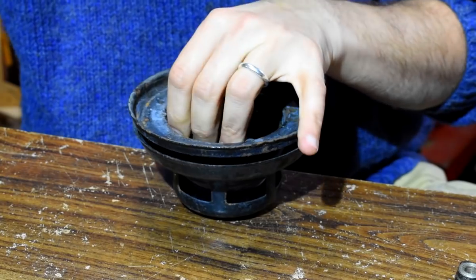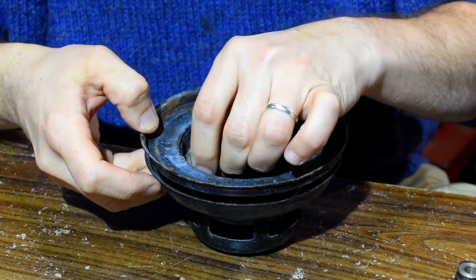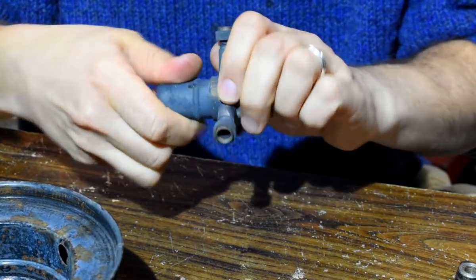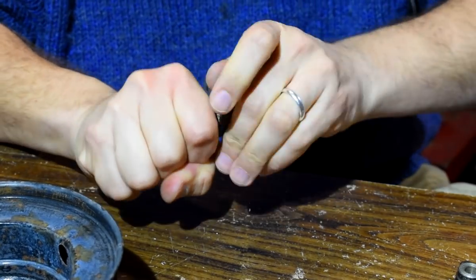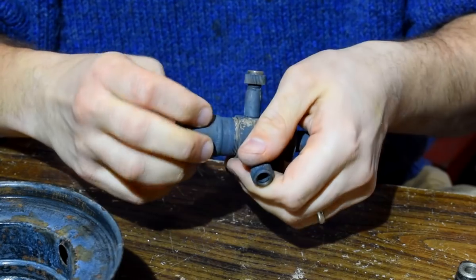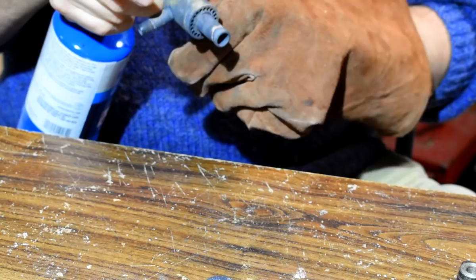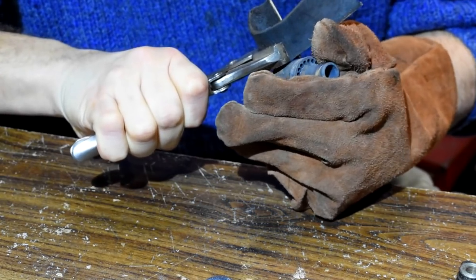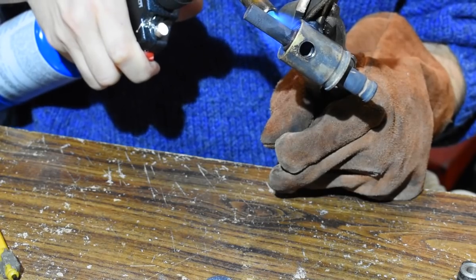The burner comes out by backing off these three little brass bushings at the ends of the air tubes. They were stuck on really tight and required pliers to get started. This burner is in really good shape and doesn't really need to come apart, but I'm doing it anyway. The top of the burner unscrews, and there's another mixing tube under there that also unscrews. The air tubes were more difficult to unscrew than expected — they all required some heat — but they all came loose in the end.